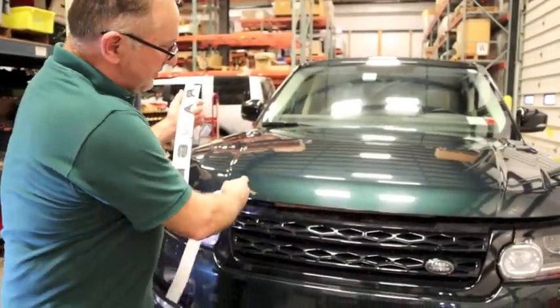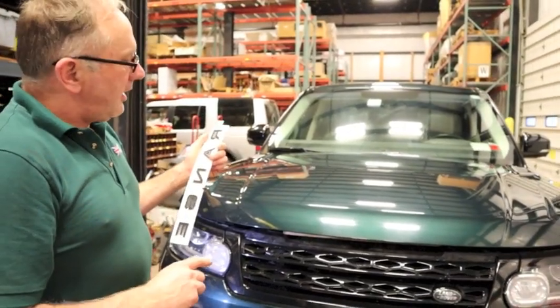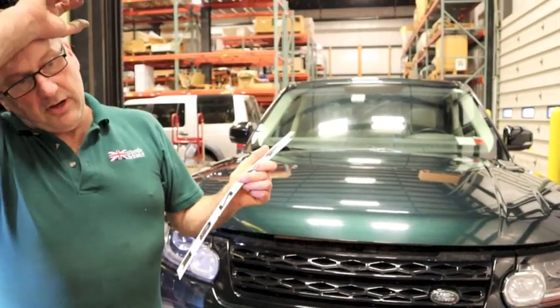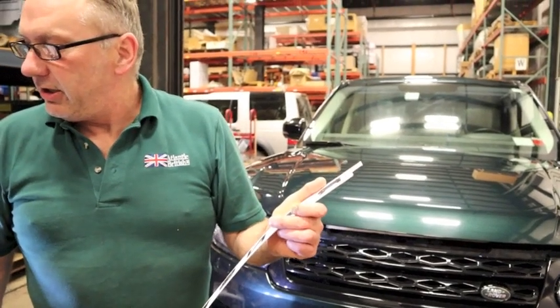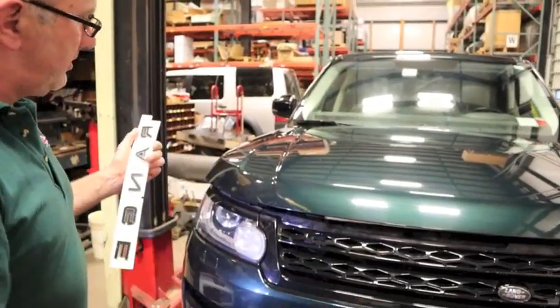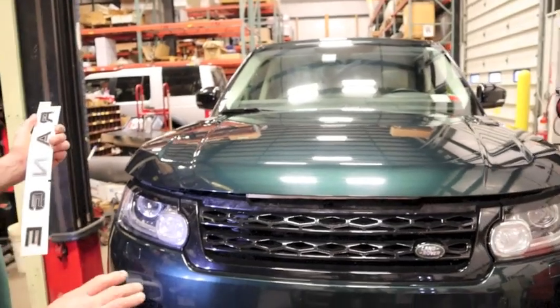As you can see, we've got the front of the hood clean. I polished it once I got the glue off with a medium coarse polish. I felt it was a little aggressive, so I went over it with a color-sensitive green polish made by Turtle Wax, and that actually brought the color back somewhat in line with the rest of the car and got rid of the swirls.